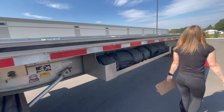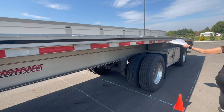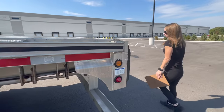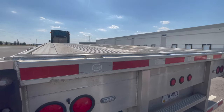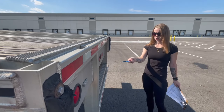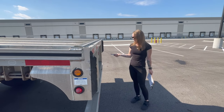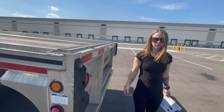The reflective tape for the sides of the trailer are present and affixed properly. The lenses for the rear side of the trailer are properly mounted and secured. They're not cracked or broken, they're clean, they're not missing, and they are in the proper color of red.